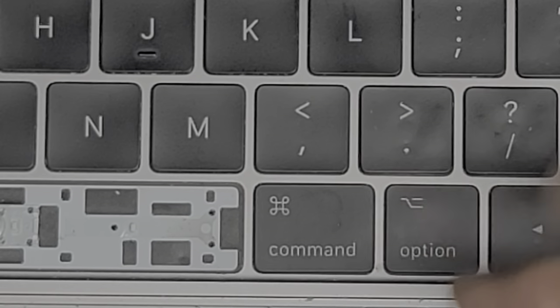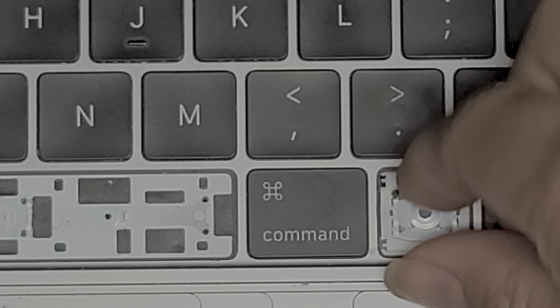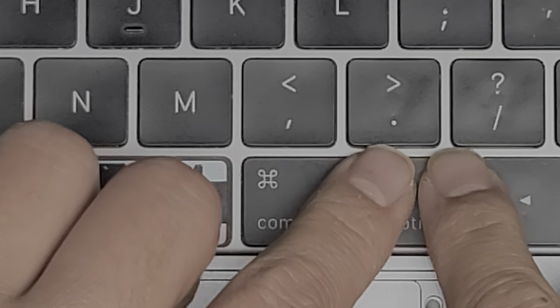This key seems stuck — I think whoever had this keyboard spilled something on it and tried to dry it with heat, that's why it's all bubbly. Once you melt it like that, the hinge mechanism is completely destroyed. Sometimes you can see what's wrong by popping the key — it could be dirt or dust. Try brushing it and using an air blower. If the key mechanism piece is fine, it might work to just stick it back on, but in this case it appears broken, probably the butterfly key mechanism itself.